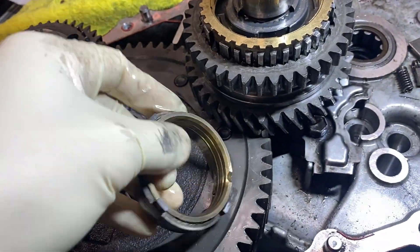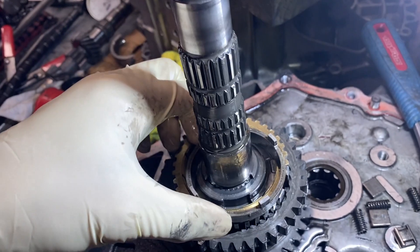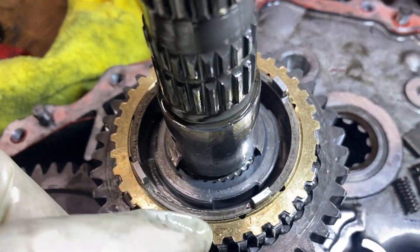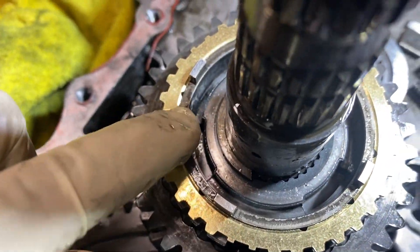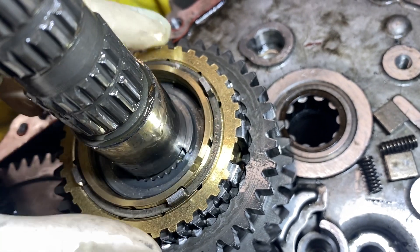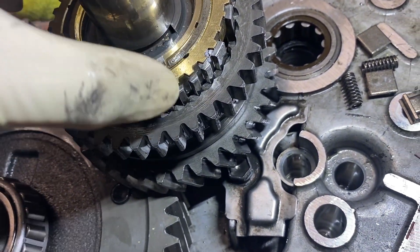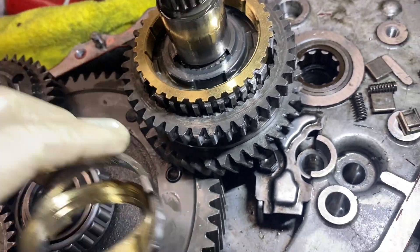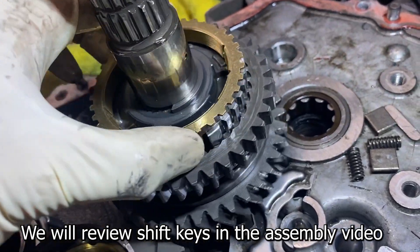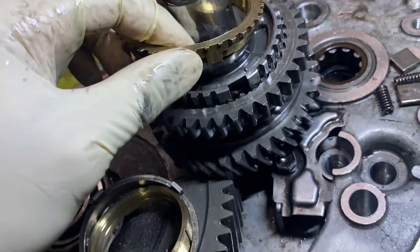There's not only a silver cone, there's an inner cone too. The inner cone can only fit in here one way - it won't sit properly when you put this thing in incorrectly. Notice it's kind of flush right there when it's correct. This guy has these little protrusions and those protrusions have to fit in that hole right there - there's one there and one there. If the protrusions are not in the right spot, see how it sits up? You've got to rotate that thing until it drops in - look how flush it is now. I already pulled all these guys out - shifting keys, springs and shifting keys. Those fall into here and there's another one on the other side. There's a protrusion right here that this thing falls into.